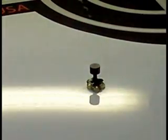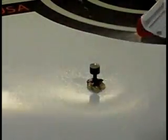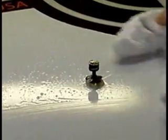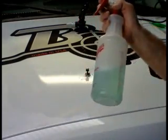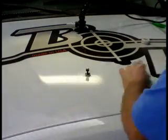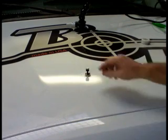I'm going to take a bottle of water and cool that glue. There's no reason to sit around waiting for it to dry unless you're going to glue a whole bunch of hail spots or multiple dents. Since I only have one, I'm going to go ahead and cure that glue. I'm using a little bit of Windex with some water — doesn't matter, it's going to work regardless. Got it nice and dry, feels like it's stuck on there pretty good.